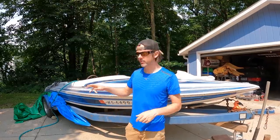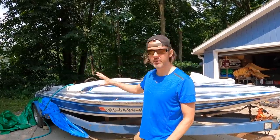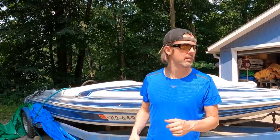All right, so now the back of the boat is pretty much trimmed up and ready to just be hit with a belt sander or a flappy disc or something to get a lot of texture for good adhesion on the resin. I still need to clean up the front half of the boat, so I need to suit up.